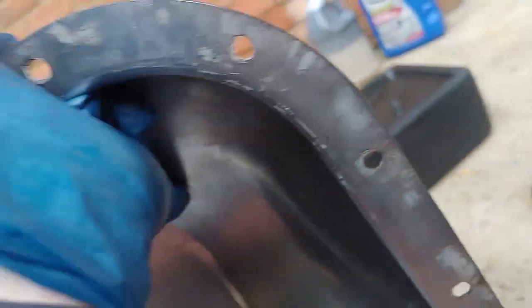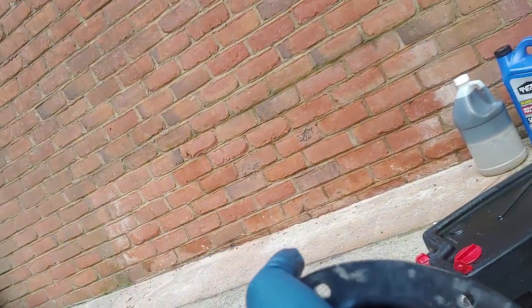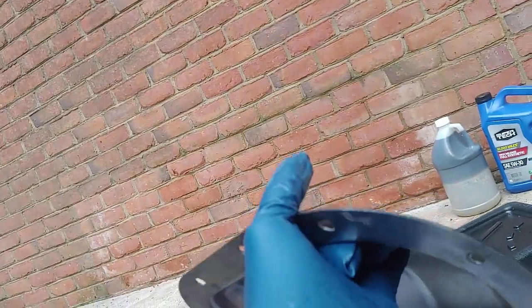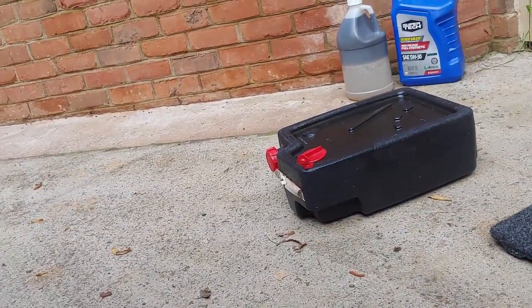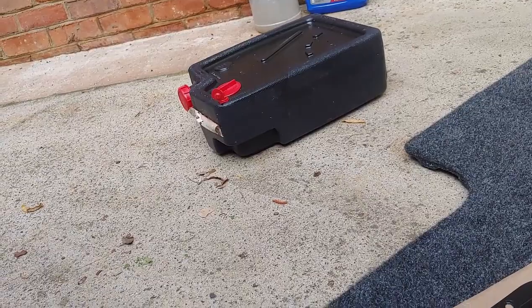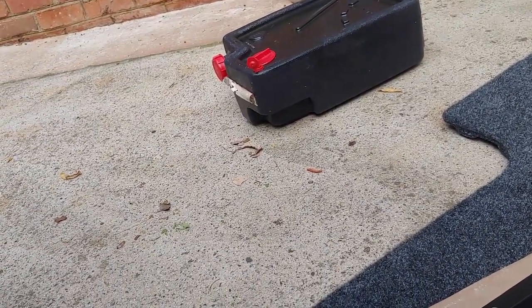And so we're ready to put everything back together, and we'll start by putting a bolt at the top. I'm going to look at this gasket and probably rub some lubricant just around the gasket itself. But I'm not going to use RTV and the gasket. I've read and researched that you can use RTV, or you can use a gasket by itself, or you can use RTV and a gasket. All three methods should not leak.